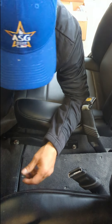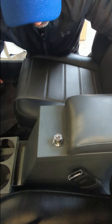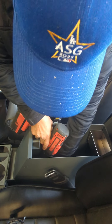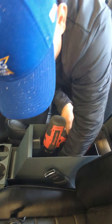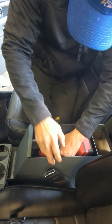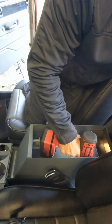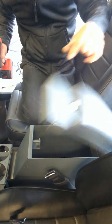So after I check that nothing is behind, I put five screws. Then I bring the center console — it's kind of heavy because it's metal. It needs screws. Even though it sits on the flat base, I will use chrome screws with washers, an inch and a half long. You need screws because even if the area is flat, it might move when the car is on the street. I want that center console to be solid. And there it is — you can see the five chrome screws. I put matching carpet to cover those screws.